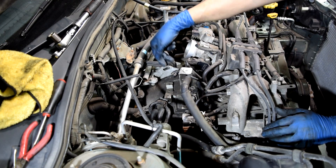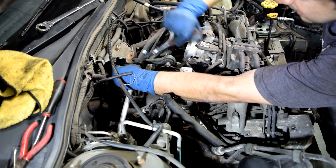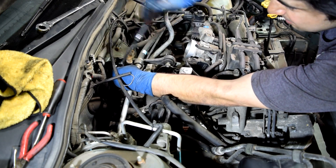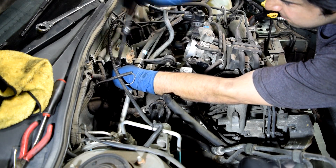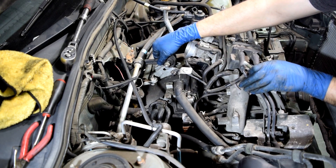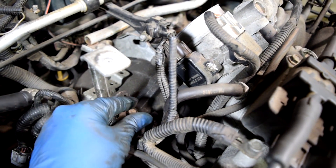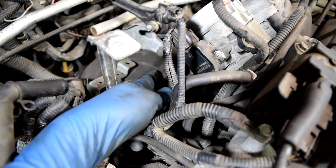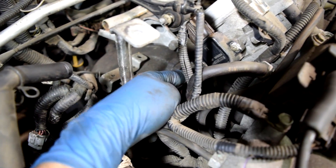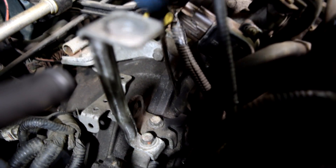This is going to allow us to raise the transmission with the engine. I'm just going to completely remove this torque mount so we've got nothing to worry about. There's another 12mm bolt in the back that you'll need to remove. Actually we don't need to completely get it out of the way — we can just lay it to the side. It's now completely loose and we should be good. Next we're going to start removing our torque converter bolts, and we do that by removing this rubber cover right here, basically right underneath our throttle body. You usually just pry this out with a screwdriver or even by hand if it's not stuck on there that hard.